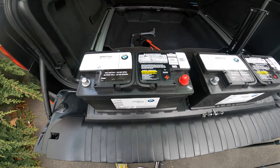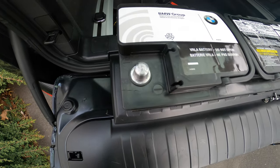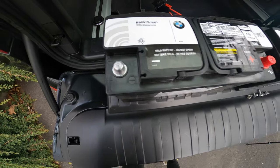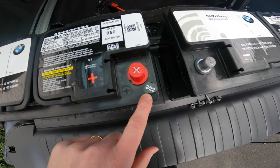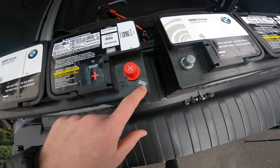Over here is the new battery. It looks like BMW may have done away with dating the batteries in that method — there's nothing stamped on the negative terminal. But they do now have a sticker, which is what most aftermarket batteries have. "2-22" which means February of 2022.